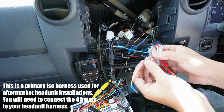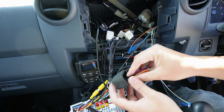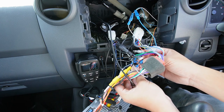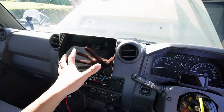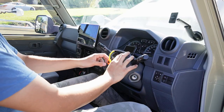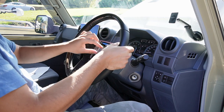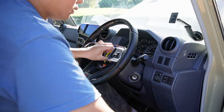I'm going to add a few male spade terminals to the Android unit harness and then plug everything in. I've crimped on two extra wires — ground and illumination — and I'm going to plug this harness back in: key one and key two. Those are my four inputs and the radio can go back in. I've refitted the head unit and also refitted the lower column trim. Now it's time to fit our new steering wheel. Pulling the clock spring pin, our steering wheel goes straight on — just making sure it's nice and centered. Then rattle gun.